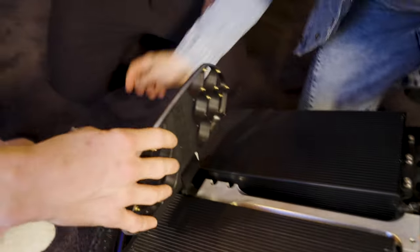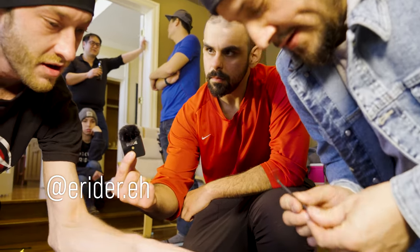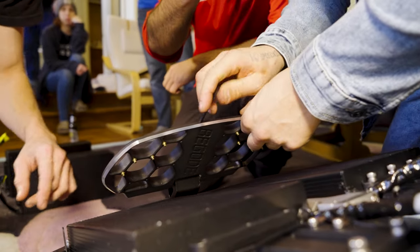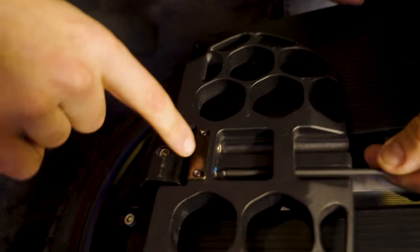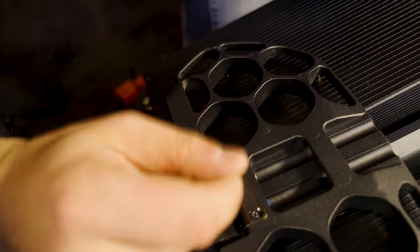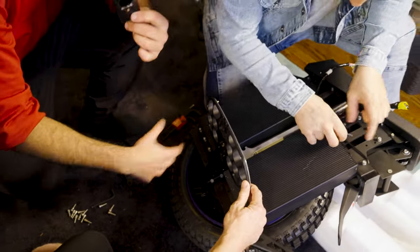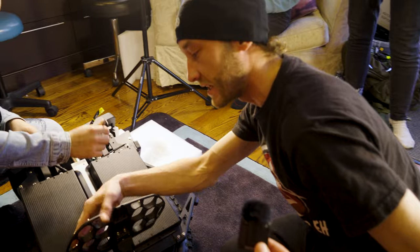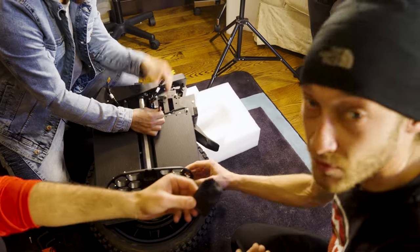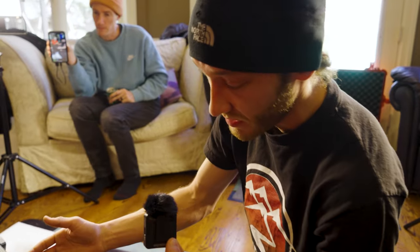It's cool how they recessed the bolt hole so you can get your Allen key right in instead of doing half-turns. As Seb just showed, serviceability and simplicity — you can now get your Allen key in a very accessible manner. This is an additional machining process to achieve it versus leaving it solid, but it's a step Bigode's taken to make riders' lives easier. They kept all the old features as well — the same nuts going through — but accessibility is a lot better.